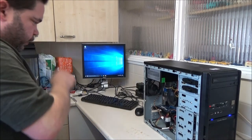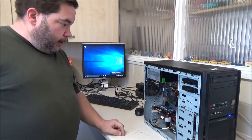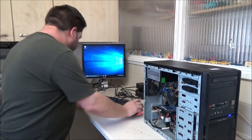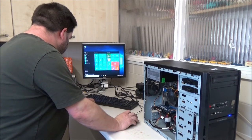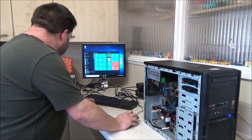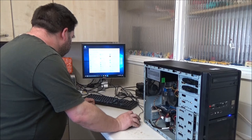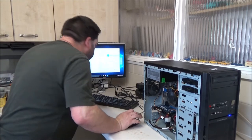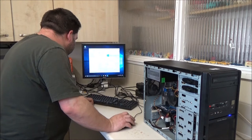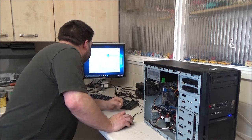There we go. Excuse me. So, I changed my mind. I put the video card in from the other machine. And I found a 2GB stick to put with the 8GB stick that I've got in here. So hopefully, when I go in and just check settings... Yes, I did want to do that, didn't I? Should. Yep. Registering 10GB of RAM. Yep. Windows is activated, blah blah blah. Intel i3-3220T, 2.8 GHz.